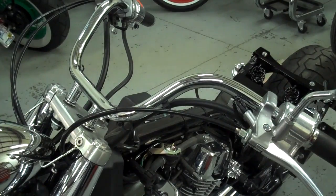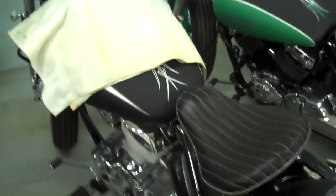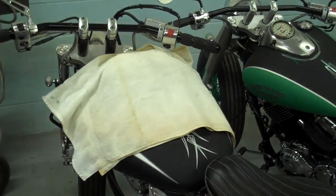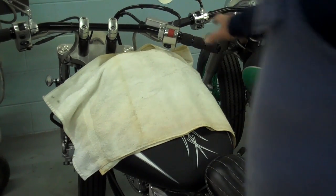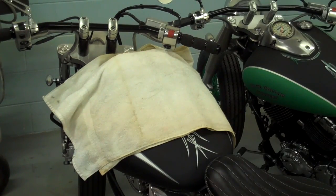I'm doing the motorcycle with the tank off — that's the best way to go. Now if you're going to do the bike with the tank on, be sure and put a towel over the tank. Protect your paint because when this handlebar swivels over, you can hit the tank and actually put a dent in it. So I angle the bars up a lot when first putting them on, then angle them down when you do your final adjustment.